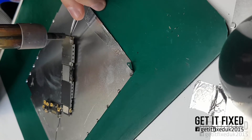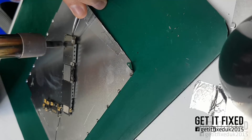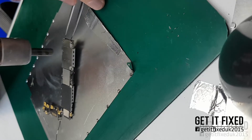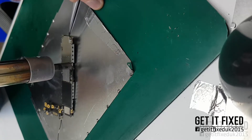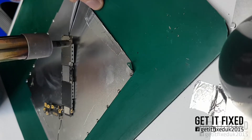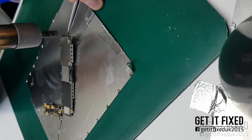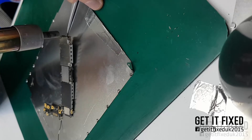What I'm trying to show you is it's not always an error if you try to restore the phone before replacing the charging IC — the main charge chip for getting more power to the NAND. If you try to restore without replacing this chip, it will cause error 4013 or maybe 4014, and by doing that you're going to damage the customer's data.